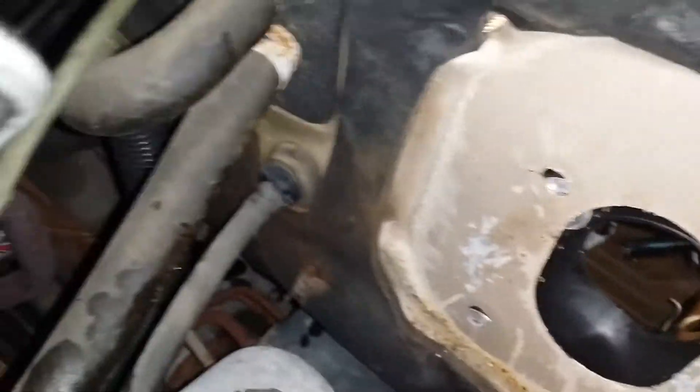Warning: high pressure brake fluid. I don't know if I need to take this out — is that part of ABS? This is the ABS pump — I guess this is the part that Chrysler would replace for free. It looks like they really protected it; they put a cover on it. Apparently there's supposed to be only one bolt, and the only bolt I see is right there. I'll take it off and see if that whole pump assembly comes out — I seriously doubt it, but we'll give it a shot. Believe it or not, this whole assembly is held on with just one bolt. Here is where it was attached — and that whole thing is gone.